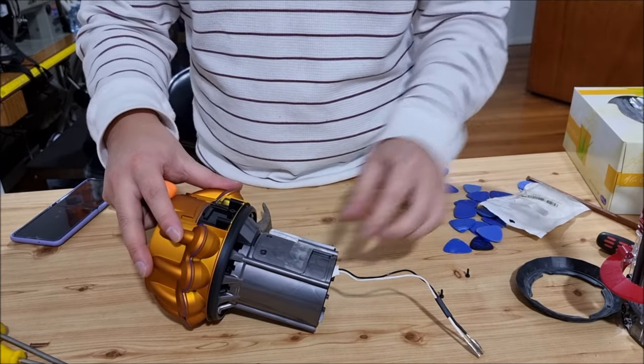We're going to rejoin the cyclone or backing head with the motor. Remember there are two rails here that need to slide in. Slide it in and compress it to see if it's fitting in properly. It should slide in and out easily. Push it in to ensure there are no gaps — if there are no gaps, it means you've slid it in correctly. We're going to put our four Phillips head screws back into the back, and two on the guide rail.